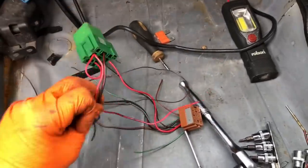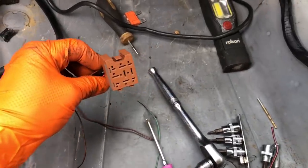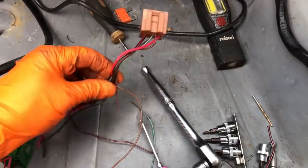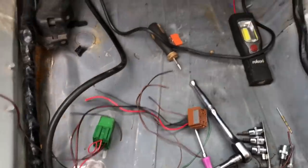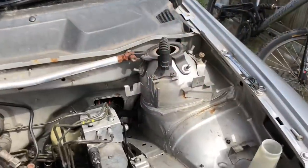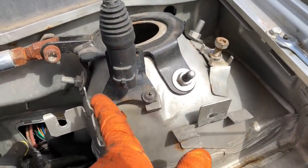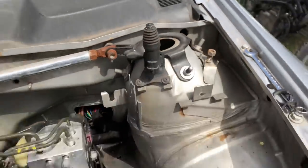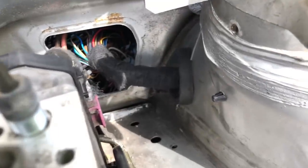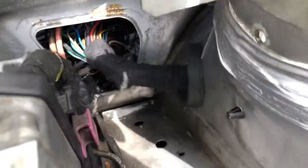Another thing - I've removed the auxiliary water pump wiring relay completely and cut it out because I haven't been running one for years, and the relay box slot was blank anyway. I've traced all the wiring back and cut it out, getting rid of two connectors. I can also remove the fuse box bracket off this turret. There was no grommet in the right size for the hole I cut, so I cut down a Cosworth grommet - the ones used on the Cosworth loom - and it fits in there spot on, giving plenty of protection against the wiring chafing or cutting.